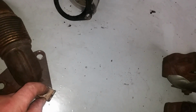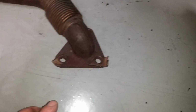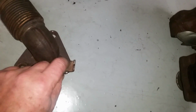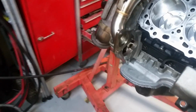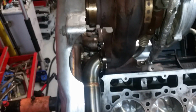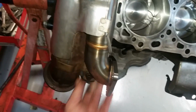And if you ever heard a truck coming up to a stoplight, and it sounds like a tambourine, and then it kind of stops, that's what that is. At least that's what it is on my truck. It always made that noise, and now I know why. I'm sure a lot of guys just take that thing out, throw it away when they do that delete. But it was pretty easy for me to find a chunk of metal, bend it, drill some holes in it, and then this piece will be supported like it should, instead of all the vibration, hanging weight riding just completely on that joint right there. So that'll help. And my tambourine sound will be gone.